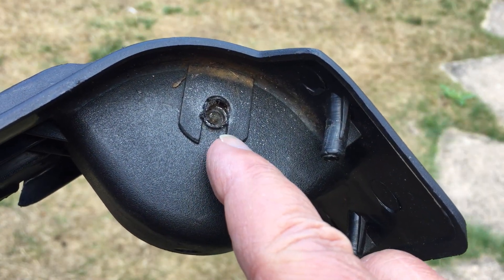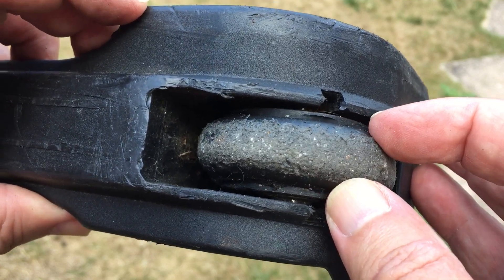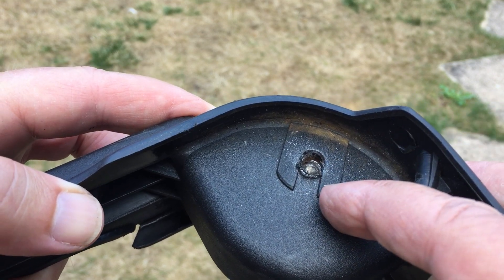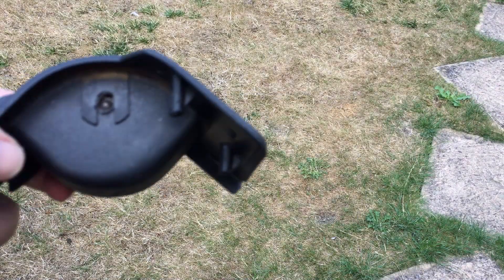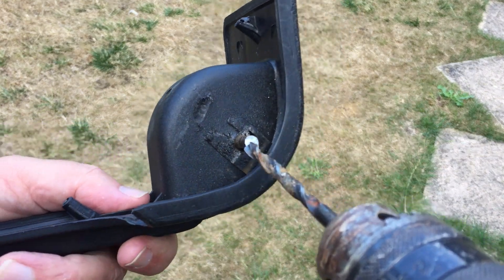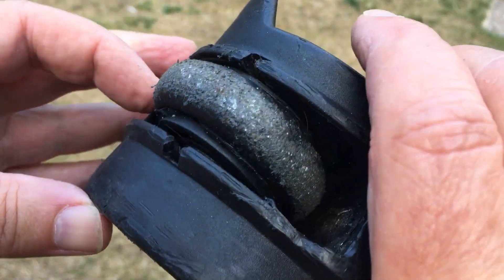Now get your drill back and either push the shaft out by hand or use the six millimetre drill bit to gently push it down. Make sure the wheel is still true, because cutting that end off could put the shaft out of alignment. You might use a punch or just push gently with the drill and it should pop out. We can then get mole grips on that and pull the shaft out.